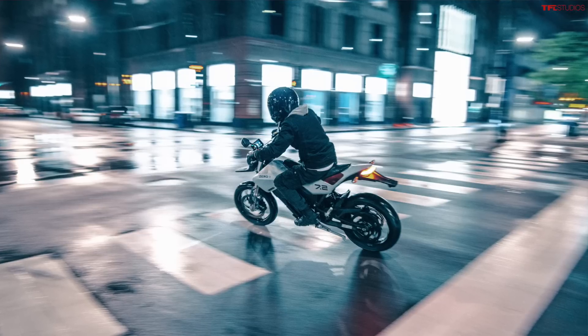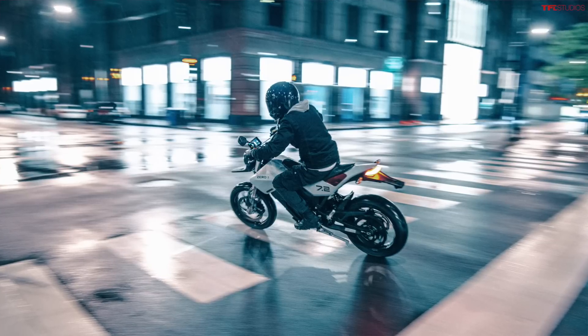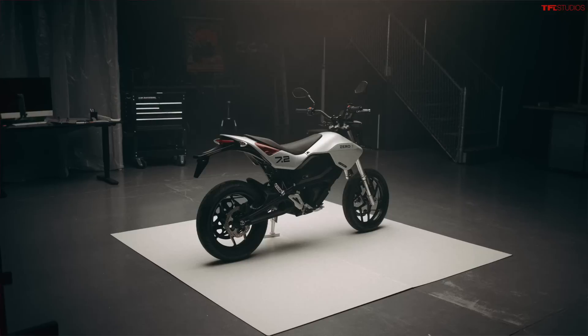It's a really crisp looking bike. Sometimes it can be difficult to make an electric motorcycle look really emotional and more than just an appliance, because you don't have an engine to highlight in the middle of the chassis, but I think this one does a good job. You get fully adjustable Showa 41mm inverted forks in the front, also a fully adjustable Showa rear shock with a piggyback reservoir — seven inches of front travel, 8.9 inches of travel in the rear. You have Bosch brakes with ABS: 320mm disc in the front, 240mm disc in the rear, and 17-inch wheels front and back with Pirelli Diablo Rosso 2 tires.